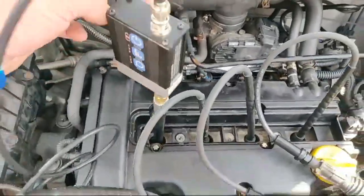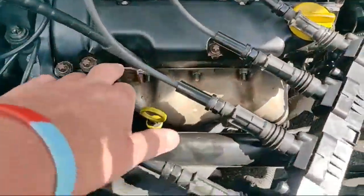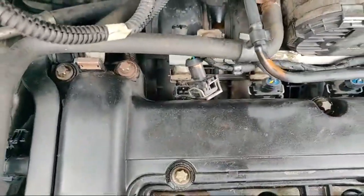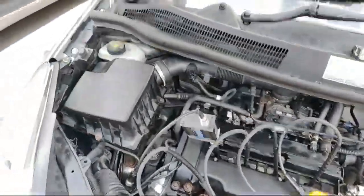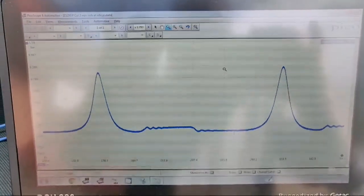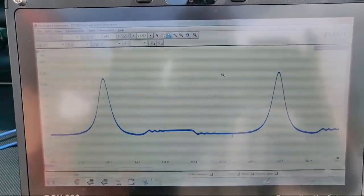We've currently got the WPS in cylinder one, but I have had it in cylinder two. We've got the coil-on-plug extension leads into the coil, the dead cylinder spark plug going down to earth to save overloading the coil, and the injector disconnected. Just to recap - this vehicle had a single cylinder misfire and the ECU was turning the injector off. It had new camshafts put in it.